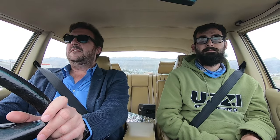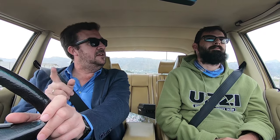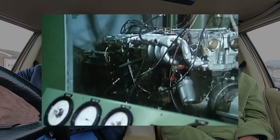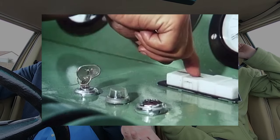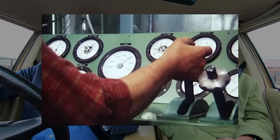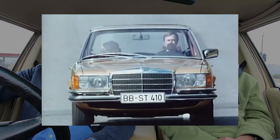Some people absolutely adore this engine, whereas others don't - they don't like the ticking idle noises. I like the fact that it sounds slightly agricultural when it starts. If you're considering a car with this engine, they rev very high. They came with four-speed automatics, four-speed manual, and five-speed manual. At cruising speeds - 110 or 120 km/h, about 70 miles an hour - they're doing 4,000 RPM or three and a half. Completely normal; these engines can do 4,500 RPM all day long. Yes, they are very thirsty, but that's comparatively speaking.